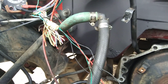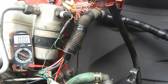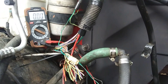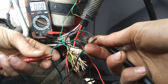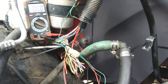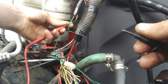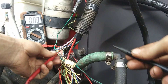Right now there's no pressure in the system, which means the low pressure switch is not engaged — it's kind of a dry system. I should be getting no power to the connector. I've got a ground and the positive connected and you can see there's no power on the voltmeter whatsoever, so that's working like it should. This is the low pressure switch or cycling switch here — this green wire is going to be a positive wire, so I can touch my red lead there and touch a ground. You see the voltmeter goes up to 12.6.